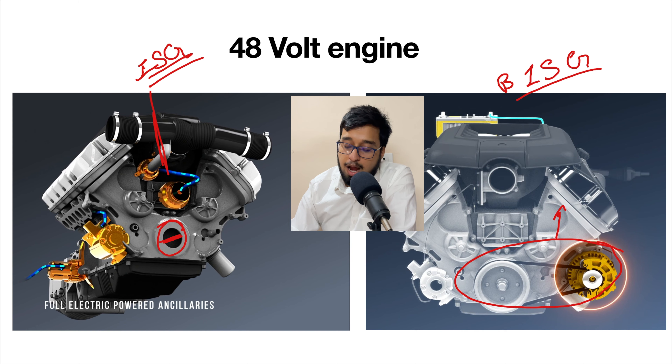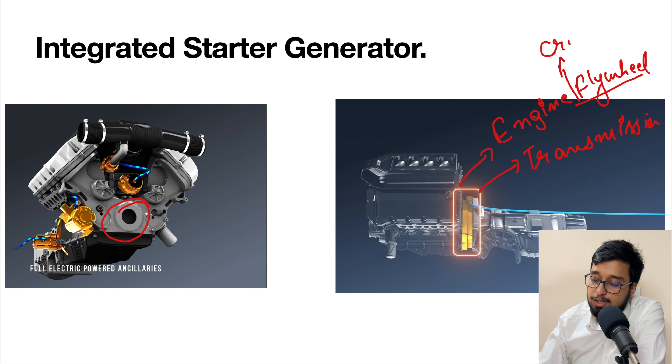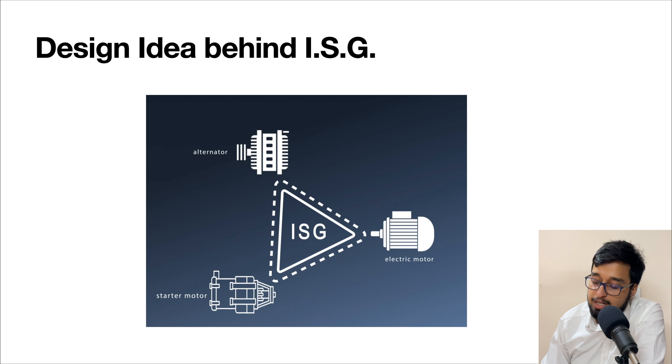So what are the differences between 48V and a normal engine? As I turn to the next slide, you will find the normal auxiliary components have vanished and you will see a difference in configuration. Now we look at the 48V engine configuration, which looks like this — we don't have anything driven off this side. The major configuration we will find in the Indian market is the Belt-driven Integrated Starter and Generator, or BISG. There are also pure ISG systems, and we have 12V architecture alongside this system to support the engine in different conditions.